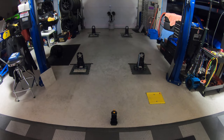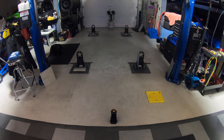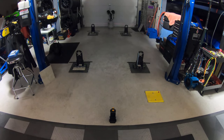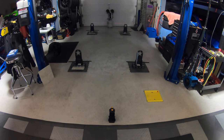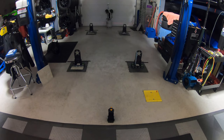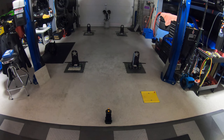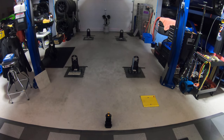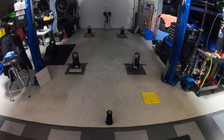Full-blown race shops use chassis plates. My particular shop has a concrete floor, which when it was poured seven years ago was reasonably level, but they settle over time. So basically what I do is I'm setting up the hub plates at the location where the car is going to rest, and I'm using a laser level.